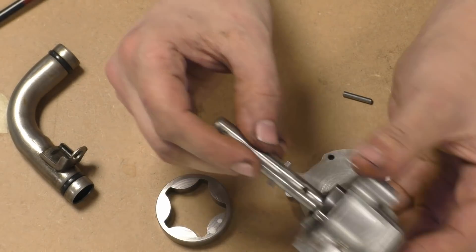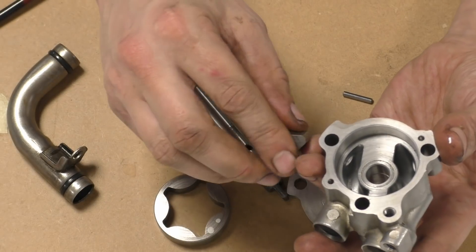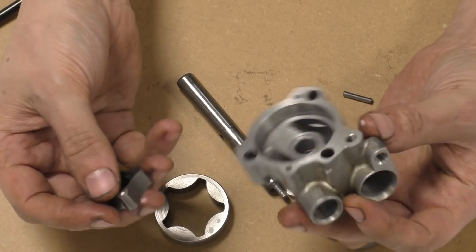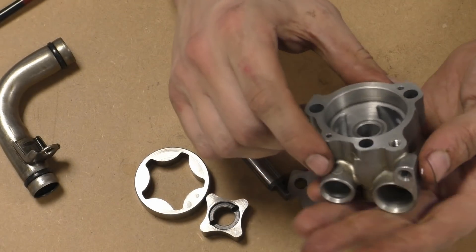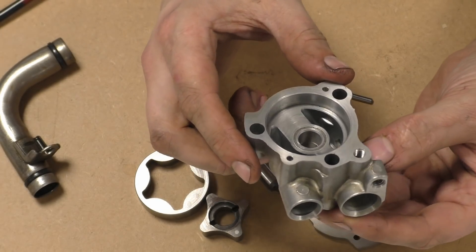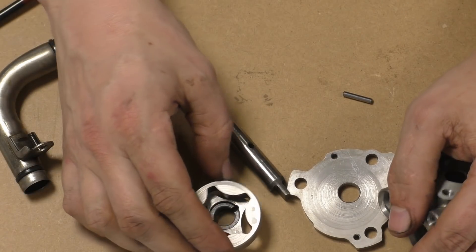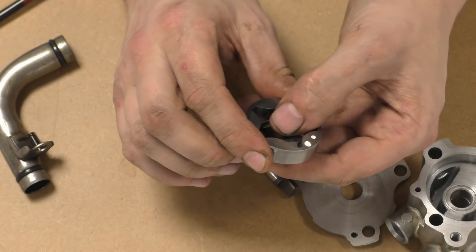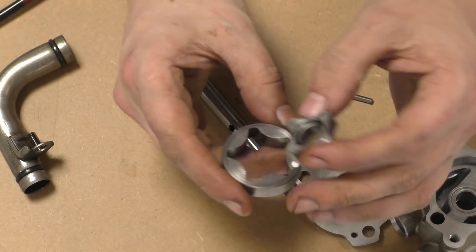Not a very cheap process. Ground shafts — that's quite basic — and there's quite a lot of grinding going on. Casting the aluminium housing is pretty cheap, they don't care about that. The boring is an accurate process, just like any kind of line boring or boring. You can measure with a feeler gauge how much play you have, and you can see these components are very tight together.